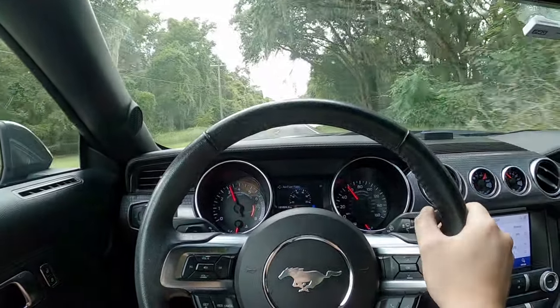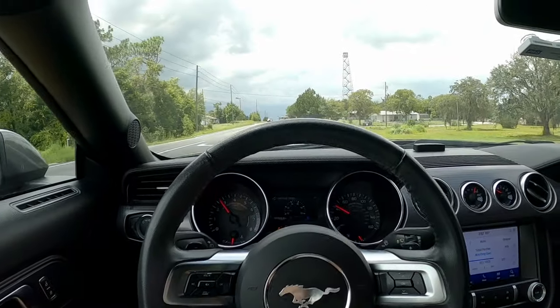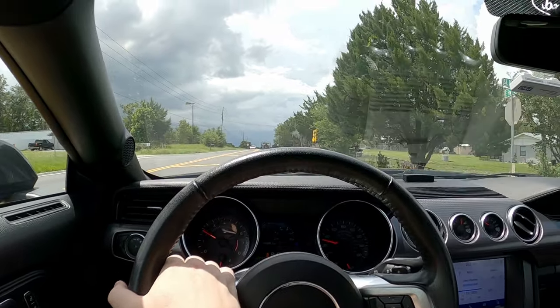I don't know what happened there, but it just locked me out — it never recorded the pull. I quickly turned around and redid the pull. I just hope the car didn't have too much heat in it by that point. But I can tell you there is a lot of hesitation — a lot. It felt a little bit stronger at one point, but overall this didn't feel as good as the spark plugs before I side gapped them. Buster didn't seem to really like that too much. It just definitely feels like it's running more rough.